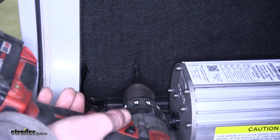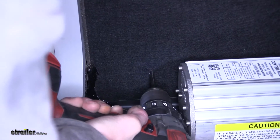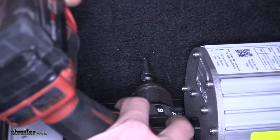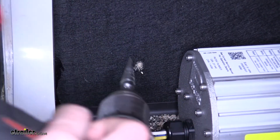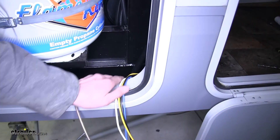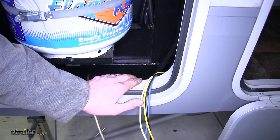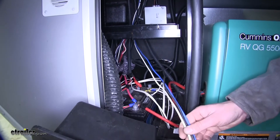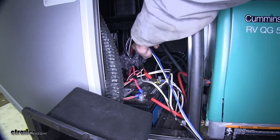Now we need to get our wires over to where our trailer's electrical wires are, or your junction box depending on how you're wiring this up. I'm going to drill an access hole through this panel to get the wires to where our trailer wires are. We'll enlarge this until it's big enough to pass all of our wires through. With the wires placed through the hole we drilled, they come into another compartment in front where our trailer wiring resides. We'll route these wires over and start making our connections — the black, white, and blue wires come out next to the compartment where we need to tap into the factory wiring.